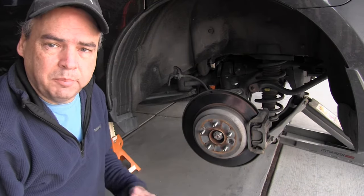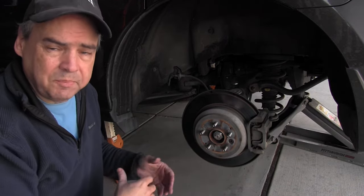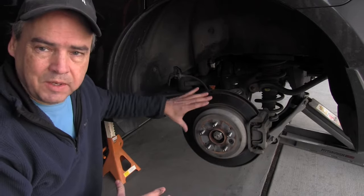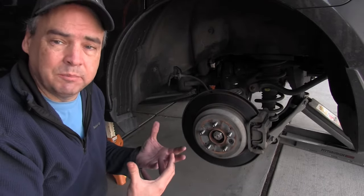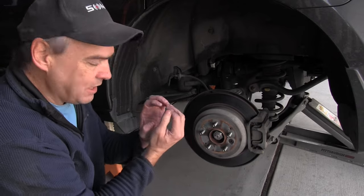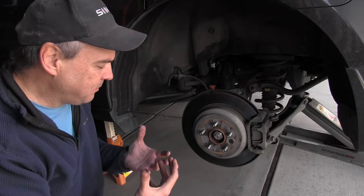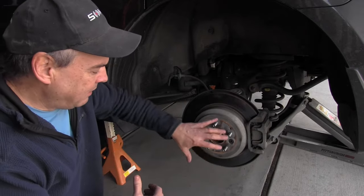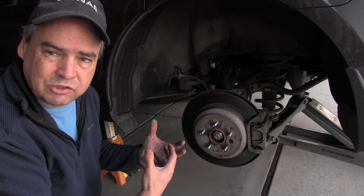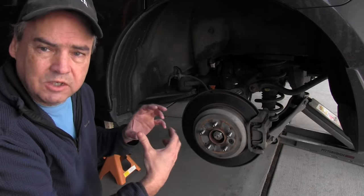You may or may not be aware of this, but some cars actually have multiple brake pads and shoe setups on their rear wheels. The main braking system is a pad and disc system, but there are also brake shoes here — that's the emergency brake or parking brake. They're behind this rotor hat, and just like a drum brake, there are shoes in there that when you set the parking brake, they expand out and press against the hat of the rotor, and that's what holds the car in place. To adjust that, I've got to get access to it through a little rubber grommet — a little plug right here — that I need to pull out to give me access to the adjustment star or mechanism to adjust the parking brake.